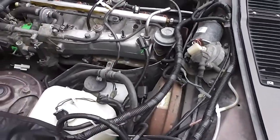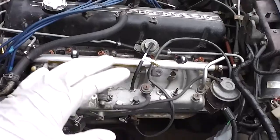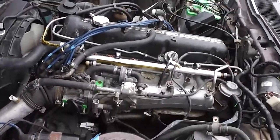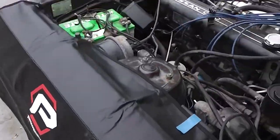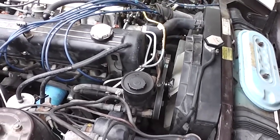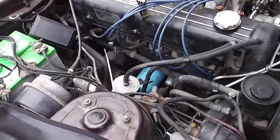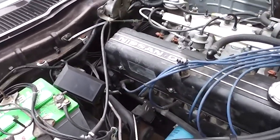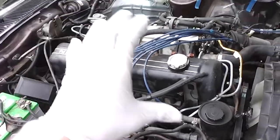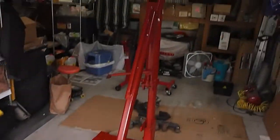I've already started removing stuff. I have the MegaSquirt harness all off the engine and out of the way. I started taking off accessories — cruise control, climate control disconnected, fuel system disconnected. The main things left before pulling the engine are the power steering pump and on the other side the AC compressor, which need to be detached and stowed. Other than that you also have the radiator, starter, both engine mounts, and the heater core to disconnect. I'm not pulling the engine and transmission together.